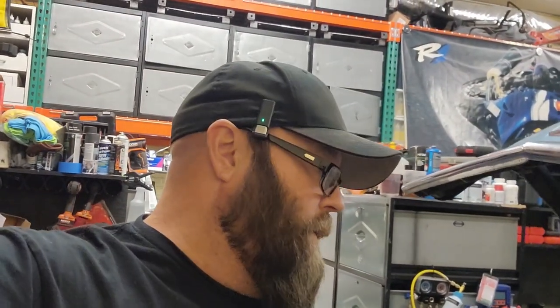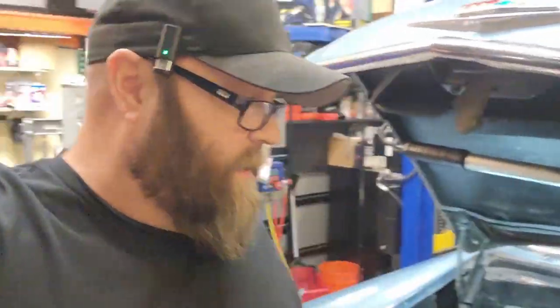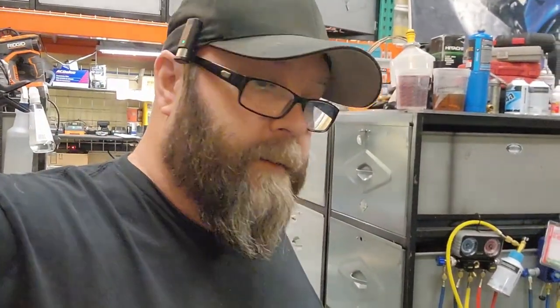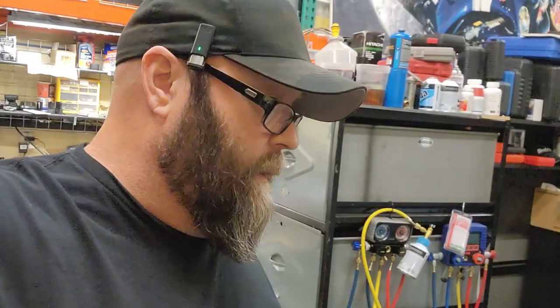O'Reilly's has got one. All I need is just a 63 amp standard, because we ain't running AC or nothing like that on here. And even if we are, 63 should be enough. But I'm not going to be running AC on here for quite some time, if I do ever. We'll see. But we'll pick up that alternator on the way in tomorrow after work. And get that one taken apart.